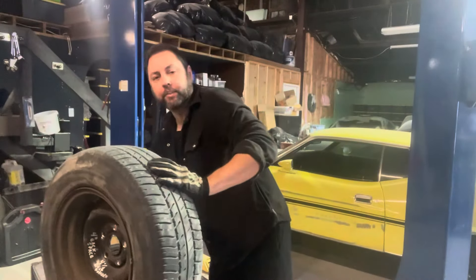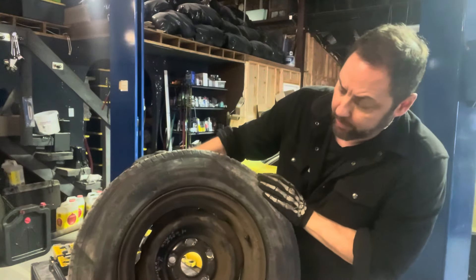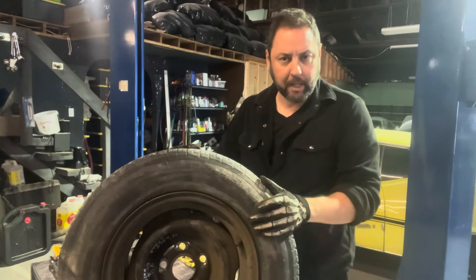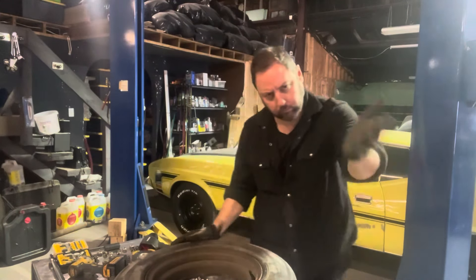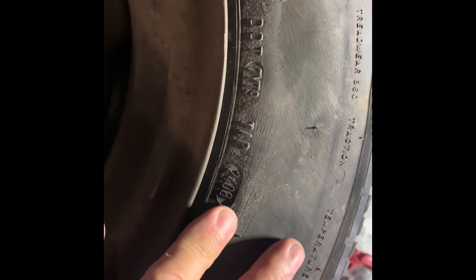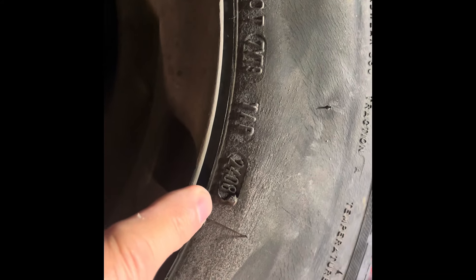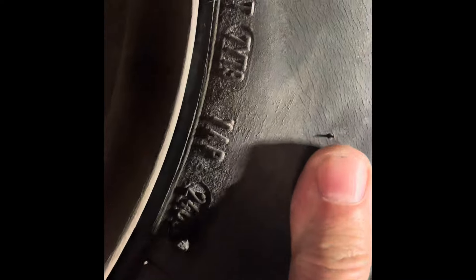Let's see when these were made. There is pertinent information we can glean from one of these tires — the Department of Transportation mandates a date code showing the manufacture date of every tire, and these are old. If you're looking at an old car and the tires look okay but you're wondering how old they are, the DOT code followed by numbers is what you want to look at. This number 2408 designates that the tire was made in June of 2008. So this tire is currently close to 16 years old — probably needs to be replaced, and you can see it's rather crunchy.